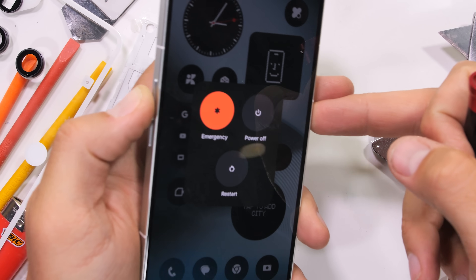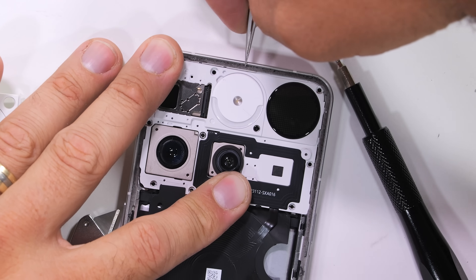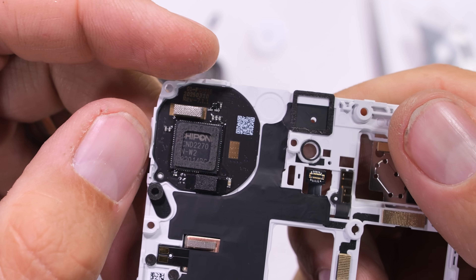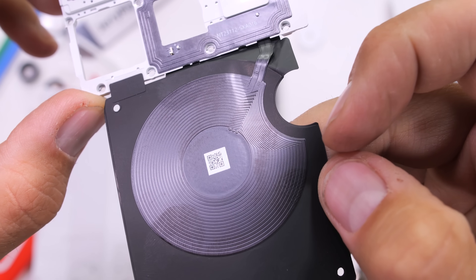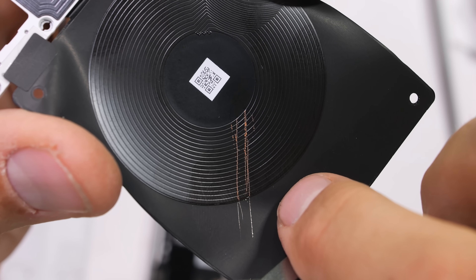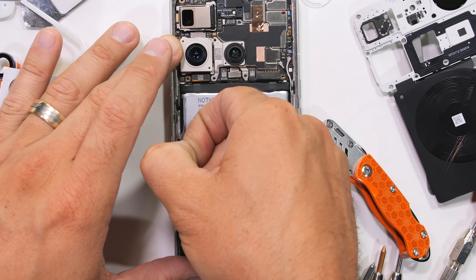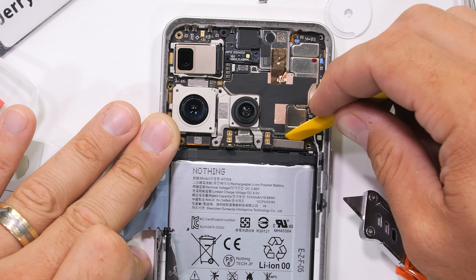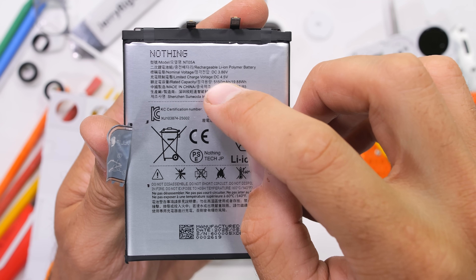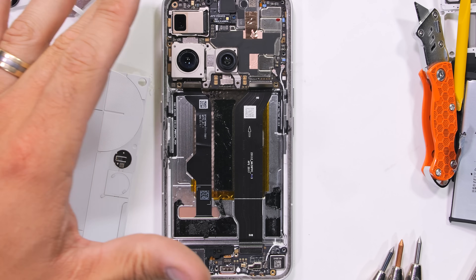The capacitive Glyph button has a ribbon that runs through the plastics to contact pads on the bottom, which then sends signal to the charging port board that has gold receiving pins. After turning the phone off, we go deeper, removing seven visible black Phillips head screws. The very last screw is hidden under the flash diffuser, where the Glyph Matrix screen is also plugged in. The Glyph Matrix screen is coin-sized with 489 individual pixels. Curiously, the rear wireless charging pad does not have its copper coils coiling in symmetrical circles — to make room for that Glyph button, the circle has a Pac-Man looking mouth cut out, which makes me think about what next year's iPhone could do — but at least now we know wireless charging pads don't have to be perfect circles to generate an electromagnetic field. The battery can come out easy enough — thumbs up for that. Pulling the single plastic strip releases the 5150 milliamp hour battery. Rumor has it that India gets a special version of the Nothing 3 with an even larger battery inside.